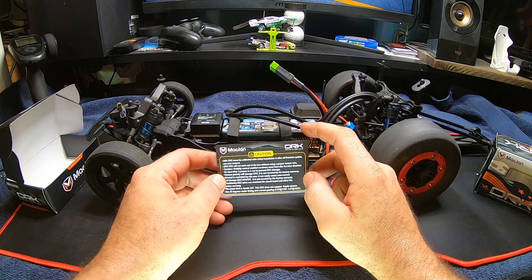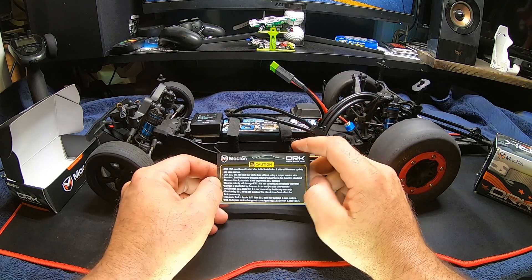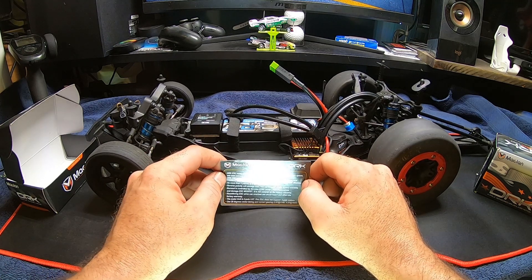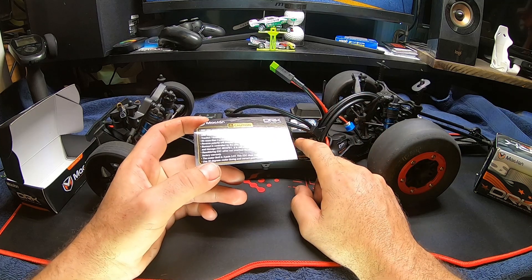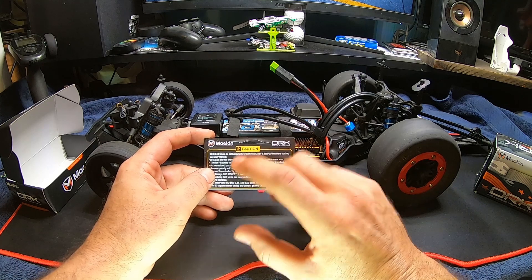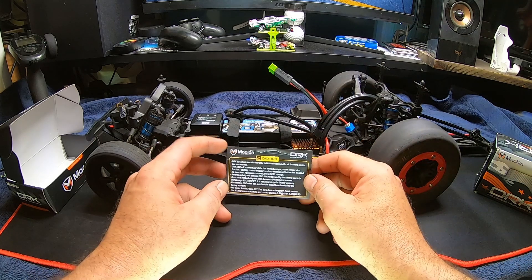If you run a four-pole in a two-pole setup you're probably going to burn something up. Unlocking the ESC to get the four-pole setup does void the factory warranty, but when it comes to racing you can't really warranty something that's going to be abused. It's like buying a 3,000 horsepower engine — there's only so long it's going to last. That's no reflection of bad quality; it's actually a great company with great customer service. There's certain gearing you want to stay within on your final drive.